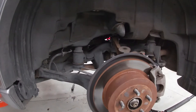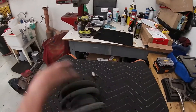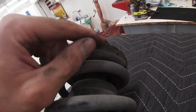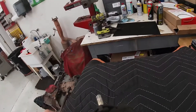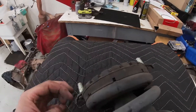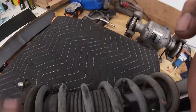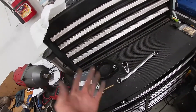When you start putting it back together, it is really difficult because now you have an extra inch pushing down on that whole setup. If you're doing an inch and a quarter, inch and a half, or two inch, then you've got to have mercy on your soul because Subaru will not. We had to use a jack to push up the strut assembly to compress the spring while having someone pry down on the rear trailing arm to be able to get the bolt in. You could use spring compressors to collapse it a little and give yourself more room, which would probably make it simpler if you're doing it yourself. For the rear strut, we do have to take it apart — put it in the spring compressor, remove the mount, and pry off the rubber isolator.